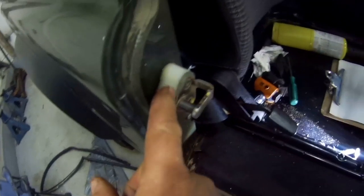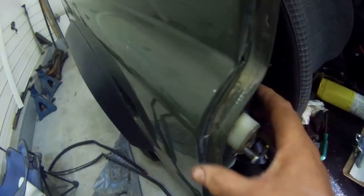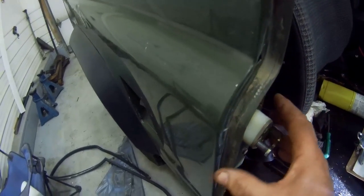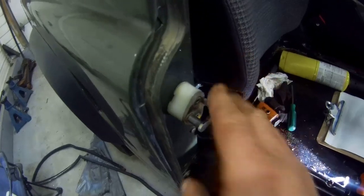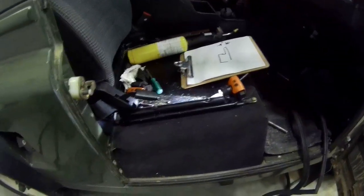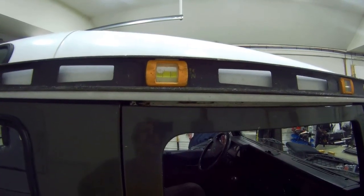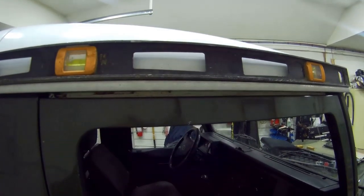Also, the constant slamming of a door tends to push the latch back over and that makes the door rattly and loose. By setting the latch up with the seal off, you can get it really nice and flush, tighten up your bolts, and get the height and depth right. But there's something else I forgot to mention — another problem of water ingress. This is an absolute stock Land Rover, not been modified one bit.